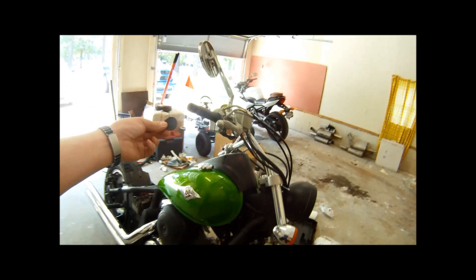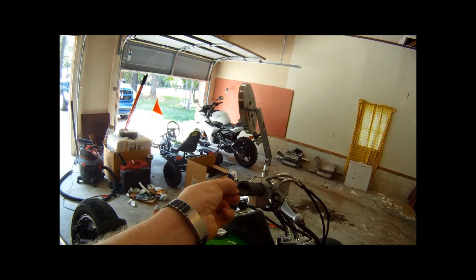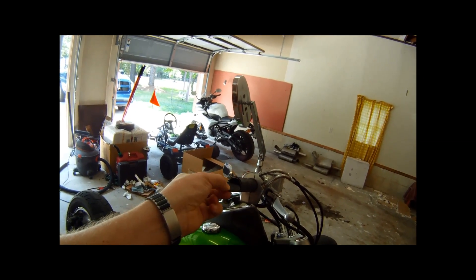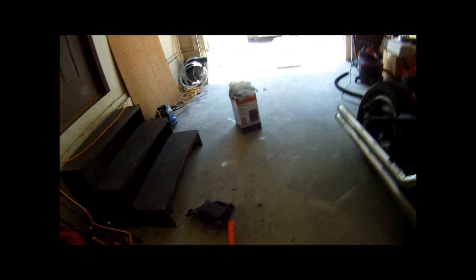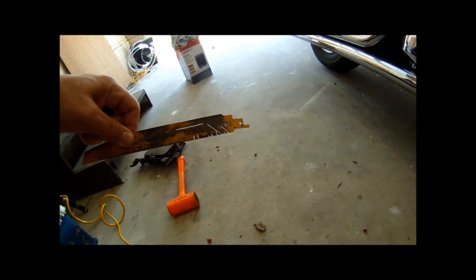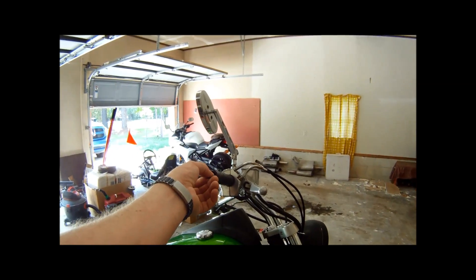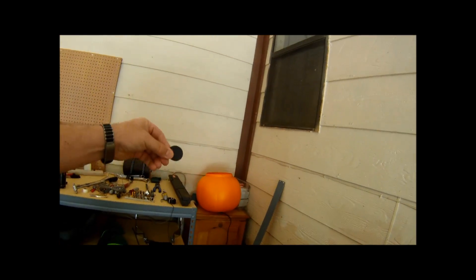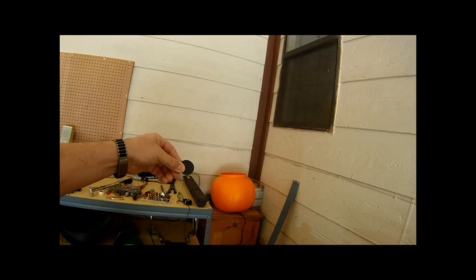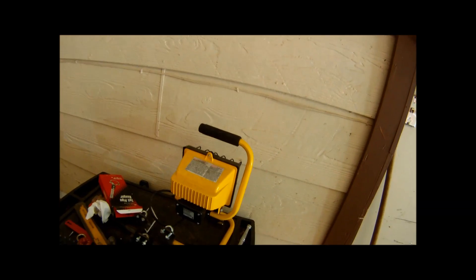Then I took one of these cutoff wheels - you can see this one is too big to get in, I've been gnawing at the bar end. What I did was I took an old blade and cut some holes in it. I wore it down to a point where it'll actually fit inside the bar. Holding it like this, I finished cutting the weld that was left and kind of ground out whatever remained in there.